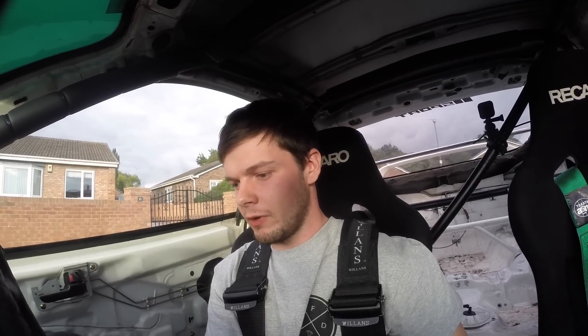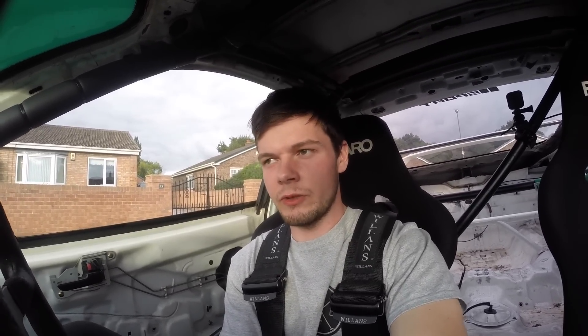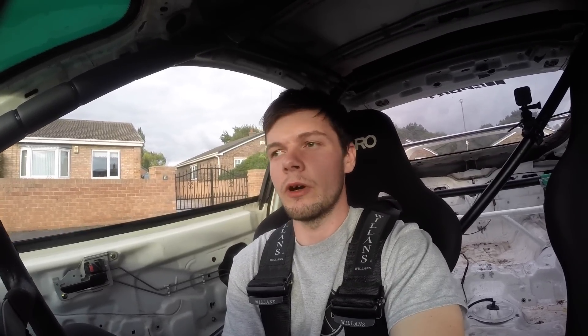I hope that gives you a quick visual explanation of what I'm doing. It's quite hard to explain while I'm driving, but the way rev matching works is we're bringing the engine speed up to speed with the gear we're going to be selecting — that's as simple as it is. It's something that once you start practising, you'll find yourself wanting to do it every day. The car I drive every day is the Audi A4, and it's still something you can do in that even though the Audi doesn't have a throttle body — it's a diesel. Let's jump in the Audi and I'll show you what I mean. You can still practise this technique every day no matter what car you drive.